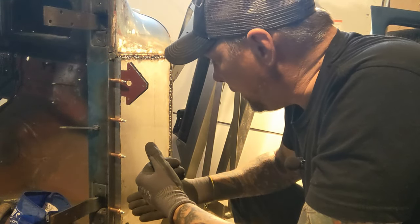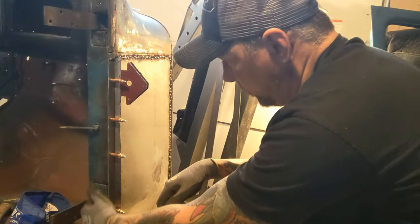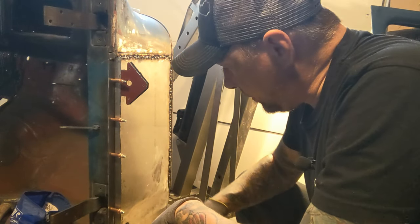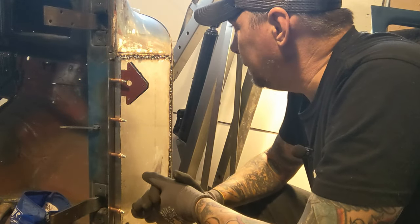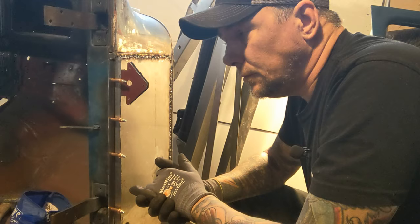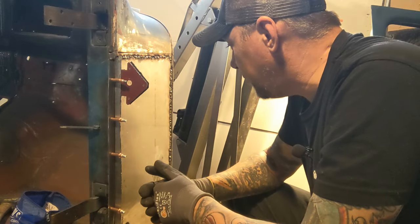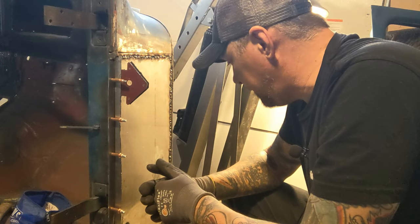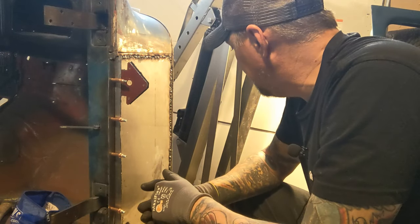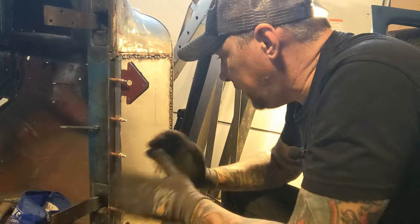This has got a curve as it comes down, so I'm going to have to cut it and work with that. Then I'm going to pop it off, take it off the body, clean it up, mark it where it needs to be cut along both edges, and then come back and continue the stitch welding down through here. It's a lot of work to build this panel — I'm obviously building it in four sections. But if this was a video of some guy just ordering the replacement panel, would it be exciting? No, anybody can do that. Really, I'm just cheap — I'm not going to spend $140 when I can spend $33.